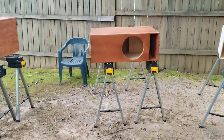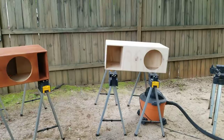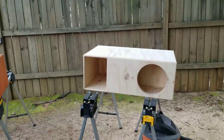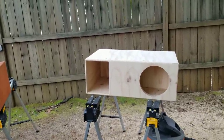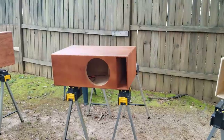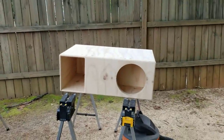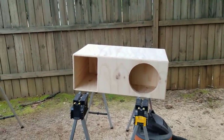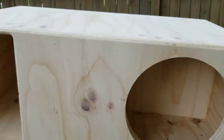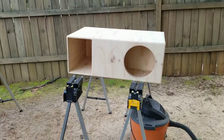Now a horn box is a totally different principle. A horn box makes bass but it actually projects sound. You put a ported box inside a trunk and open the trunk — the bass has nothing to bounce off of and you lose output. That doesn't happen with a horn enclosure, because it has its own loading chamber. That back wall is the loading chamber for the horn.